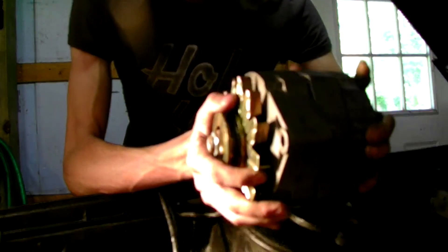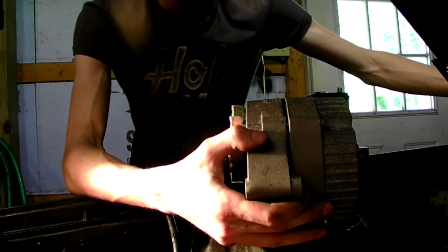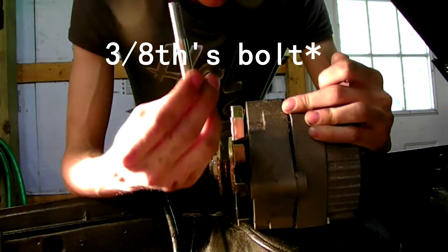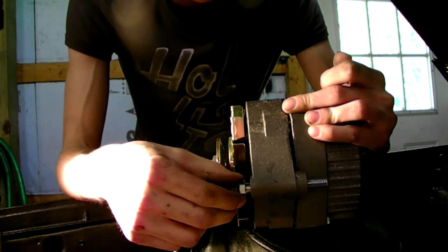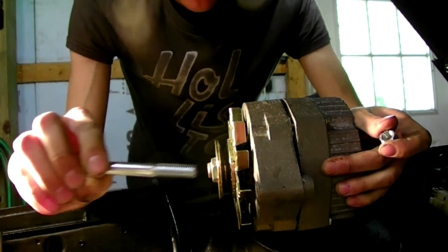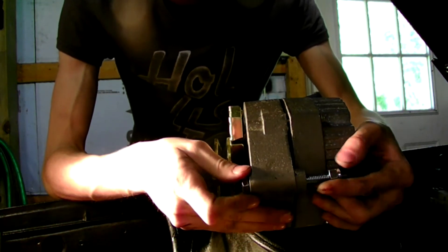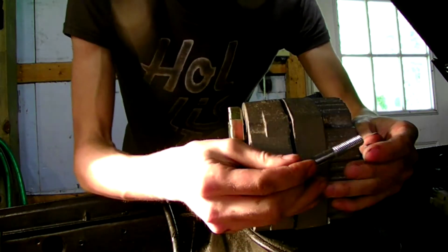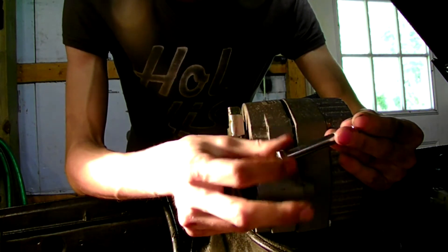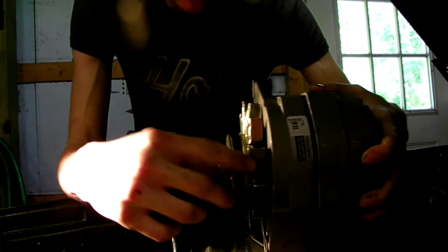The bottom is the interesting part. As you can see this flange is a lot longer. What you need to do is go to your hardware store and get a 3-inch, half-inch bolt — it fits perfect, doesn't jiggle around or anything. This is going to go through the adjuster bracket and the tensioner, then into the alternator. You slap the bolt on the back and tighten the whole system down. All I had to do was drill out the top flange, which took a whopping 2 and a half seconds.